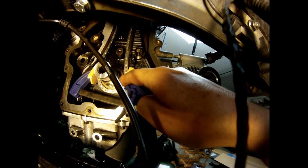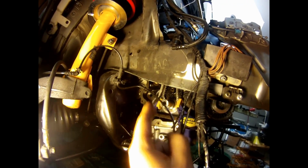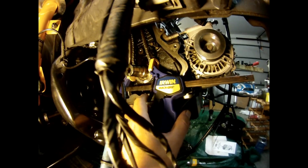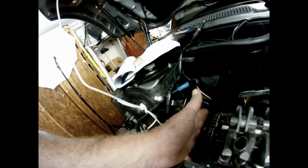And you need to know the two links. You already know how to put it back. In terms of putting it back, there are no rails here. I dropped the timing chain, and I tie it here on the hood and hold it with this. The chain was hanging, so I use this type of quick grip just to make sure the chain is properly aligned in here. Then on the top, I mount the sprocket. I put the timing tool just to give me support, and then I start bolting in.